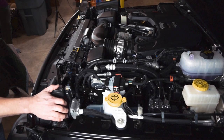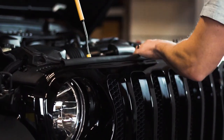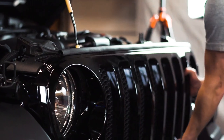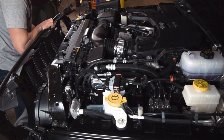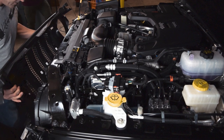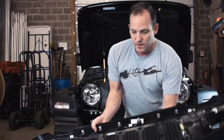Once you have your six pins removed, this is where it gets a little different from the JK. You want to pull up gently to release the top, and then on the bottom there'll be some pins that hold your grille into place — use a little bit of force. Once you have those released, set the whole grille aside on a table.